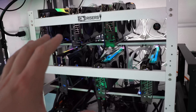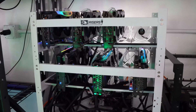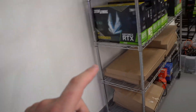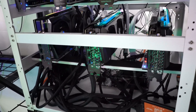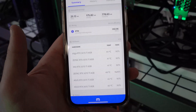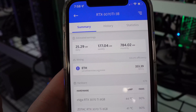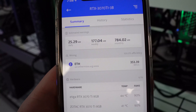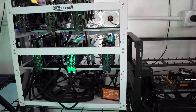What could be worthwhile is finding a cheap 650 watt power supply to power two more cards, giving a total of eight on this rig. Since I'm running on 240V I'll be on the lookout for an EVGA B-stock power supply for that. We have two more 3070 Tis we want to get mining. Pulling up MinerStat, we are pulling about 350 megahash total — about 60 megahash per card. This rig is estimated to make $25 a day before electricity, $177 a week, and $784 a month. I'll probably do an ROI analysis video on these similar to what I did with the 6600 XTs.